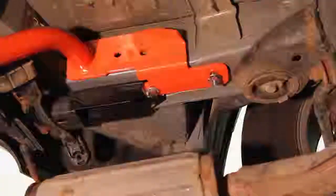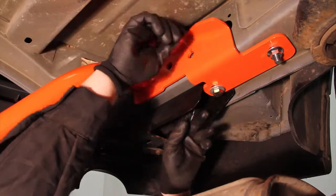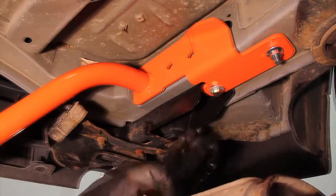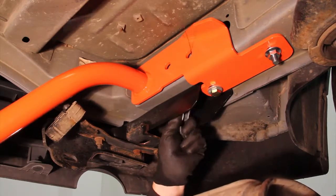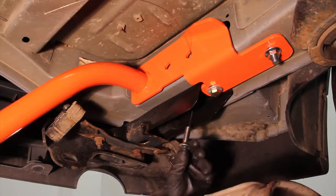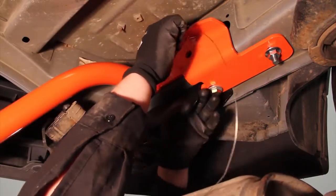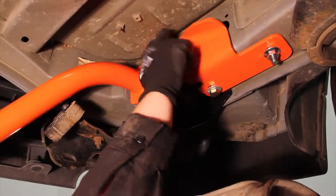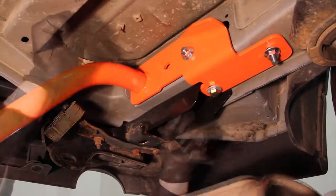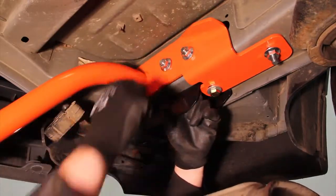Insert the coiled end of the fish wire in through the foremost attachment point of the inside of the frame rail and down through the square access hole in the frame. Place the square hole spacer over the fish wire and up into the access hole. Thread the carriage bolt into the coiled end of the fish wire and pull on the opposing side, allowing the bolt to pass through the spacer, frame, and hitch. Remove the fish wire and secure the bolt with the supplied hex flange nut. Repeat this process on the rearmost attachment point on the opposing side of the vehicle.